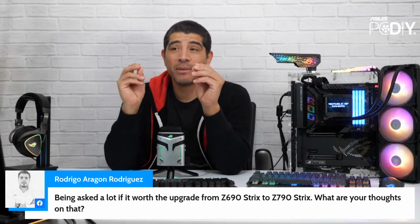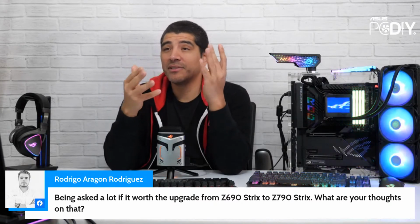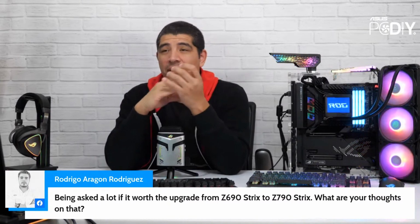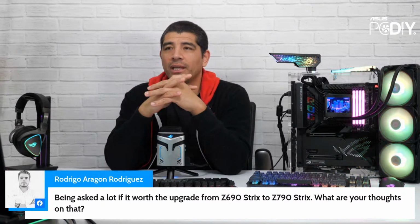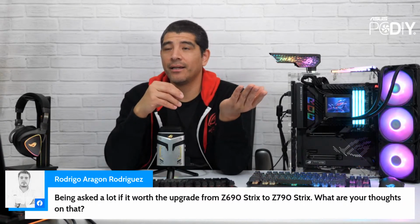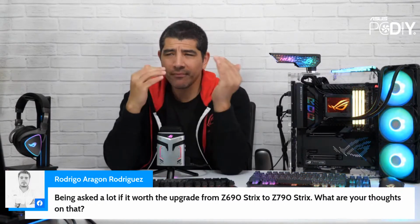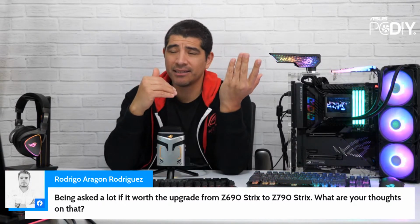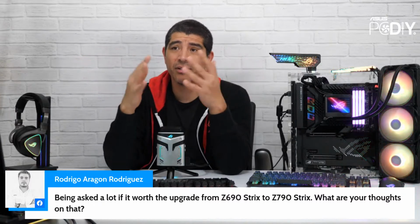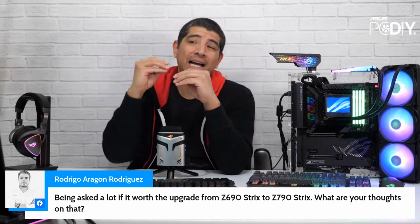Now, of course, that's still dependent on the IMC. Overall, generally, you're seeing an uplift, I'd say, in the vicinity of about 400, maybe 600 megahertz, in that range, roughly. But realistically, on a Z690 with 13th gen, you can actually have the high 6,000s, and actually even break 7,000. So it's not like it's a huge limiting factor. It's just that you have a higher likelihood of success.